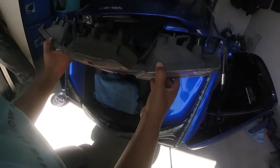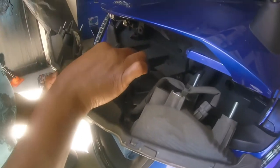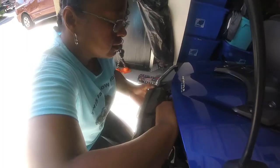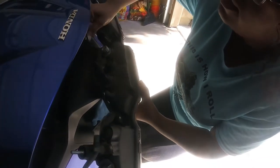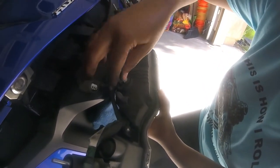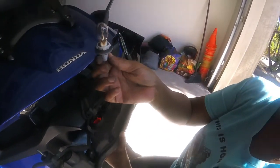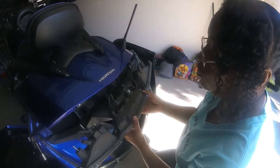With that panel removed and the four screws removed — two on each side — this just comes right out, very easy. Now the brake light is right up in here. I just took the light assembly out and disconnected the brake light by squeezing this tab right here. Now I should be able to turn it and remove the brake light. There it is — it looks really burned out.